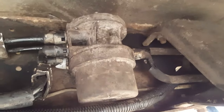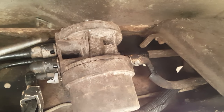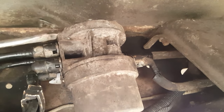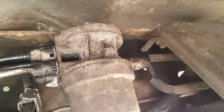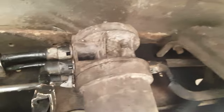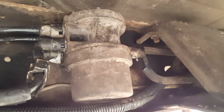Here is your front tank on top, rear tank on the bottom. You've got your feed here, and then on the other side where this white clip is, that's the return. So if you have any problems with your fuel tank, it's usually this thing — it'll go bad.